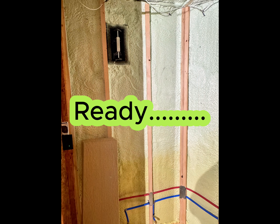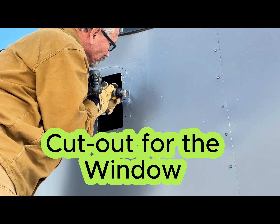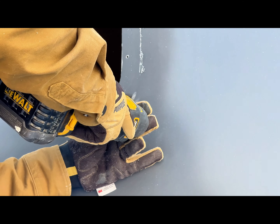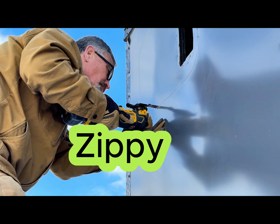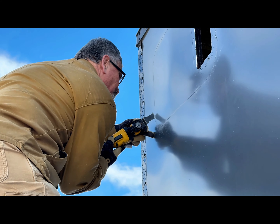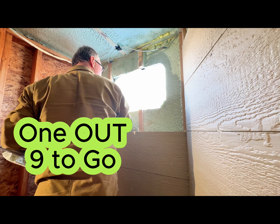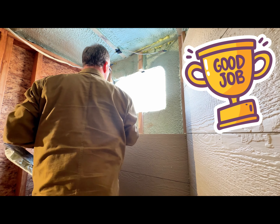So we're cutting the outside here. What we do is we tape the internal frame of the window on the side of the trailer and use that as a template to make our mark. I used a nail-embedded blade with the zippy — it stays sharp and cuts this aluminum really nice and neat. We just got to be really careful so it doesn't jump out and scratch the trailer, and now we pop it right out — and just like that, we got a hole. Nice work!